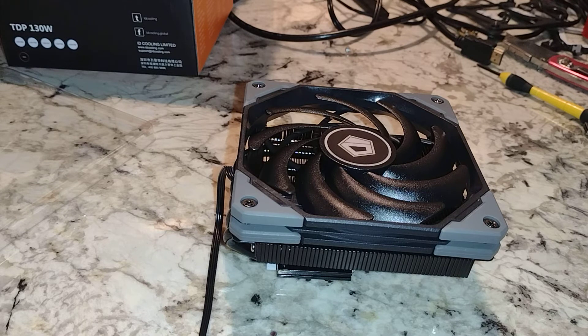Now, talking 11th gen — same deal, pretty much. 10th gen, I don't think there's a case where I would use an i7 with this. Maybe going back to an i7 8700 or something, but otherwise this is an i5 and below — definitely not meant for an unlocked processor. Could you use it with an unlocked processor? Yes, but you would want to turn off turbo boost, and then at the cost of performance you'd be dropping the amount of power used, and something like this would actually work decently. Thanks for checking out the video folks — please like, please subscribe, thank you.